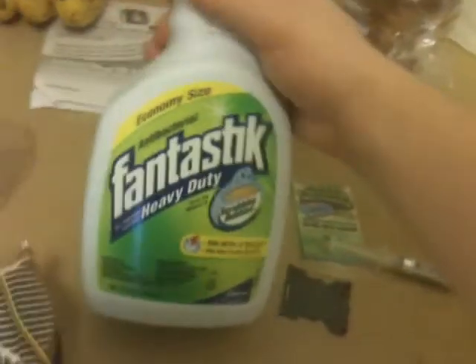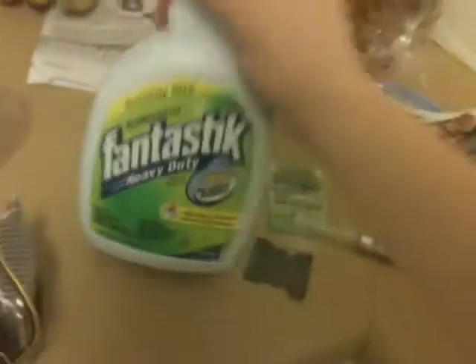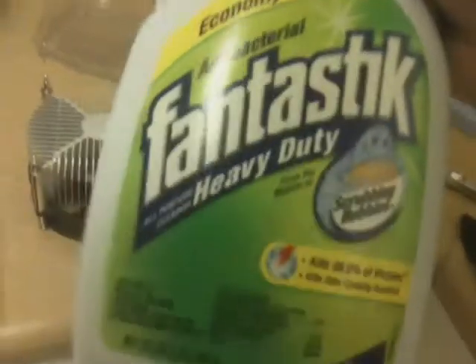Now we must prepare the cooler — not that piece of shit stock cooler, but this aftermarket one. As you can see, there's no heat sink grease on it or on the processor. So, do I have isopropyl bottles? No. Fantastic is a great alternative — just get a bottle of Fantastic, spray it into a lint-free cloth, and wipe off anything to purify it. It works very well and this cleaner cleans everything.